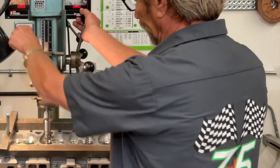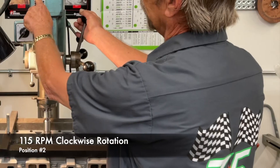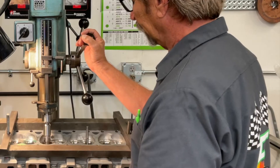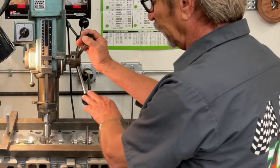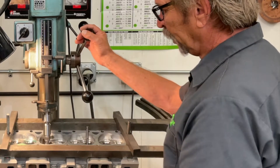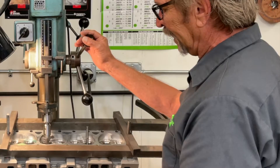I've got my machine turned on at 115 RPM — position number two — and I'll come right on down. As you can see, I'm already machining that seat. There's a little bit of chatter going on; this is a hard alloy material, but it only did it at the end.